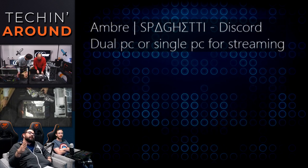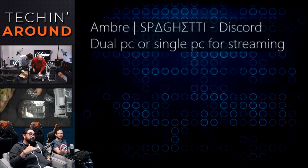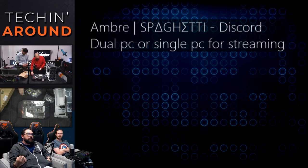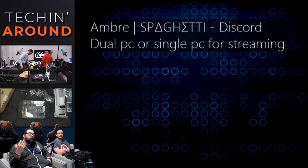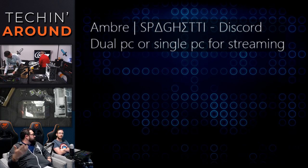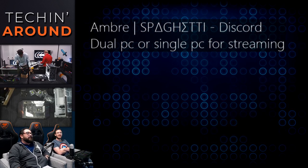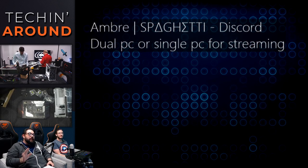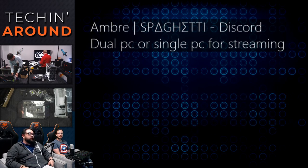Yeah, I think it's true. Everyone would recommend dual. I think the thing people don't realize, and this is kind of what I do at home, I run dual PCs as well. But that secondary stream box really does not need to be expensive or high power. I really just took what I had available and kind of Frankensteined together a second zombie PC, and that became my stream box. If you're going to make any Frankenstein PC, make it your streaming PC. It doesn't have to be graphically intense, it just has to process. That's all it needs to do. I've had a lot of success with dual PCs, and if you have the means, get that second PC up so you can really take your stream to the next level.